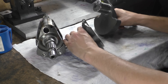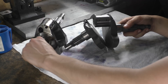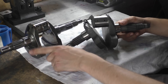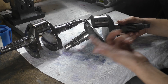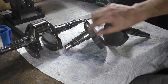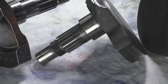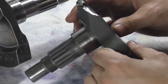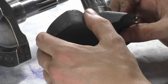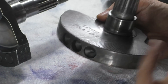How can you tell the difference? Well, the main differences — because you might dig out your crankshaft or what have you — is you can see the surface finish. The surface finish is one of the easiest ones to see. Someone did ask: is it that this is a more expensive crankshaft and they've spent more time finishing it off? No — this is forged and this is cast. You can see that this has this sandy, grainy structure to it. If we just zoom in, you can see it has this sandy, grainy texture — this texture here.